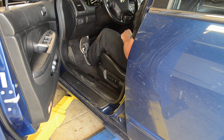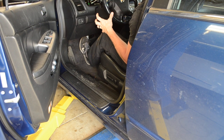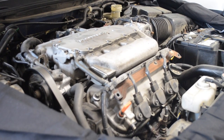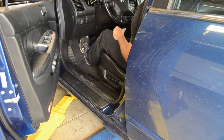So I'm going to shift into drive. My foot is on the brake. I'm going to give it gas. What I'm checking here for is a thumping sensation while I'm sitting in the car, as well as excessive engine travel — which I can see the engine over the top of the dash here. It's moving quite a bit. That tells me the front engine mount is bad.